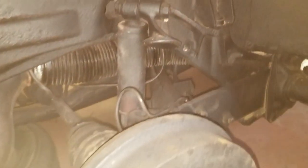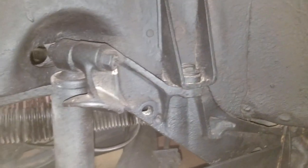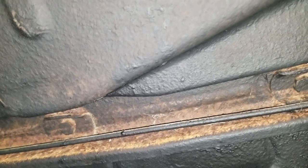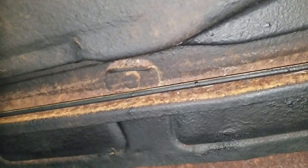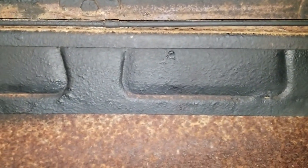The couple underneath the gas tank for the suspension. Here's the primary frame bolt. You've got 1 on the front of each of the shocks, so we did have to take those off. Here's the underside picture of the chassis bolts. Once again, get those off and then slightly try to raise it a little bit with either a flat blade knife or a trowel to separate the glue from the frame and just gently lift up.